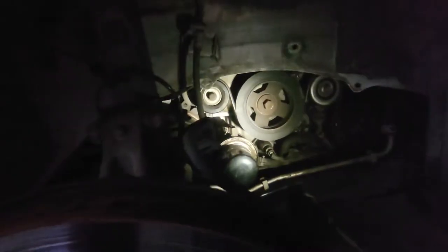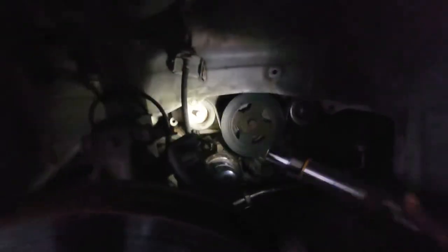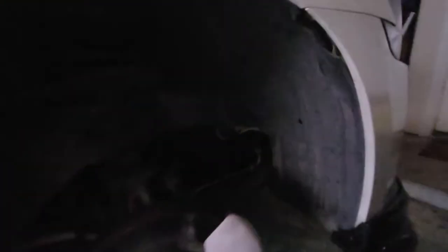I got the alternator end connected, but the other side I couldn't reach, so I had to pull the tensioner all the way down until the socket was nearly touching the oil filter — all the way down — and place the belt around there. It's going to be a tight squeeze, I'm not going to lie. Unless you want to take the panel off, but I wouldn't even attempt that — it's too much work. That's basically how you do it.